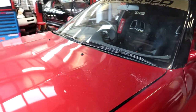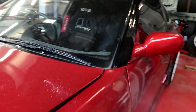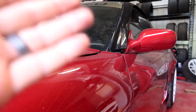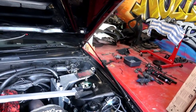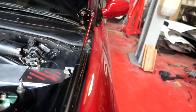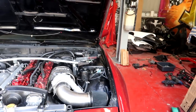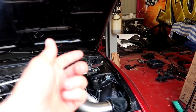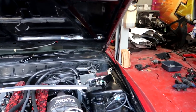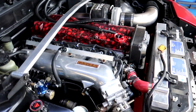Okay, this is the vaping that I'm talking about. I'll try and capture it on camera - it's hard to see. You can see that vaping coming out of here. Yeah, you can see the vaping straight out of there, which would say that it's got a lot of blow-by. That catch can is a really well-made one that actually catches the oil, and I guess the fumes are just blowing out. So it's not nice.